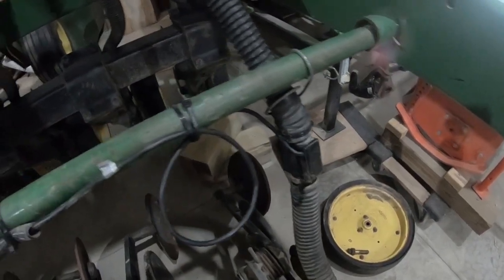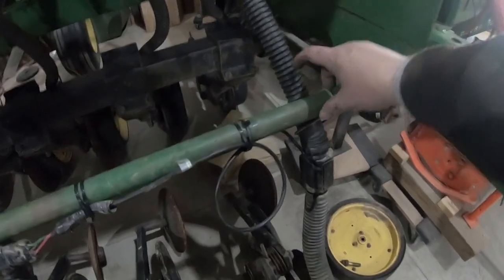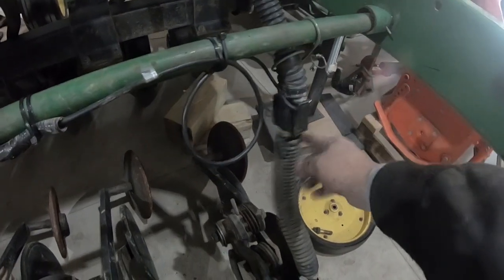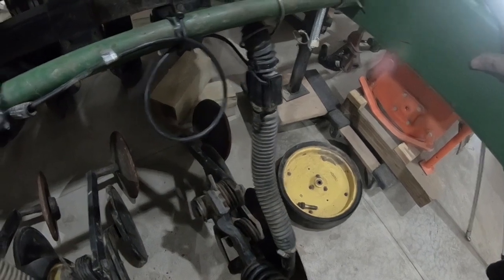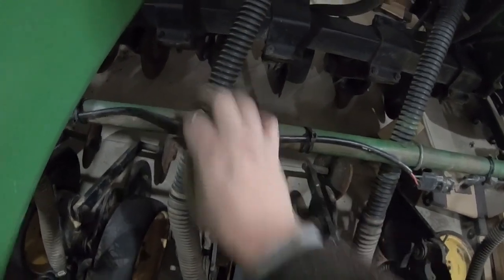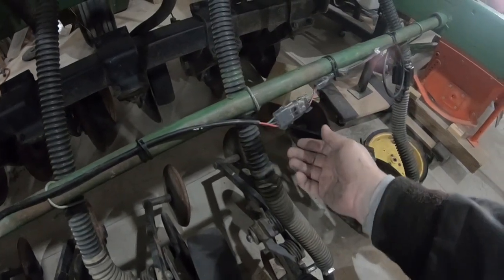We got this side pretty much strapped up. I ended up cutting about 4 or 5 inches off of this one here. Then used a little adapter piece here and then just slid the other C-tube on there. It worked real good. Strapped across. Now I'm gonna come back here and in these spots here, I'm gonna put a little wire loom. So if this slides around, it doesn't rub that wire. I think we'll be all right there.